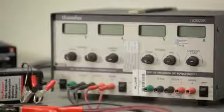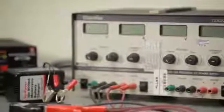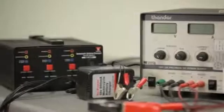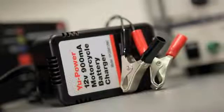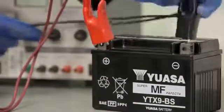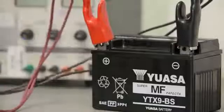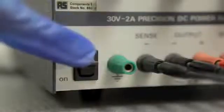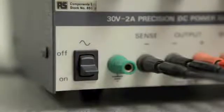Be sure the charger meets the needs of the battery you're charging. Sealed-type batteries require a higher voltage charger than conventional types. Proper charging is essential to ensure maximum operational capacity and longevity of a new battery. It also helps prevent electrolyte leaks that may damage a vehicle. Failure to follow the proper activation procedures not only leads to premature battery failure, but also voids the warranty.